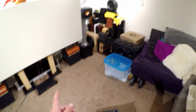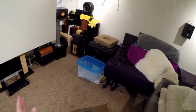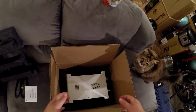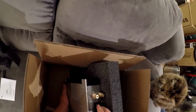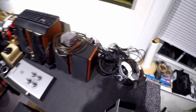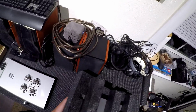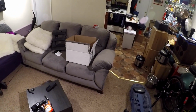And when I put an 8-ohm set of speakers up there, I could pretty much clip those amps. And that means 650 watts should be coming out, and it's not. And I've been looking for a replacement for those. And the Vidars came up on my radar as one of the possible things I would replace it with. They're only 200 watts.